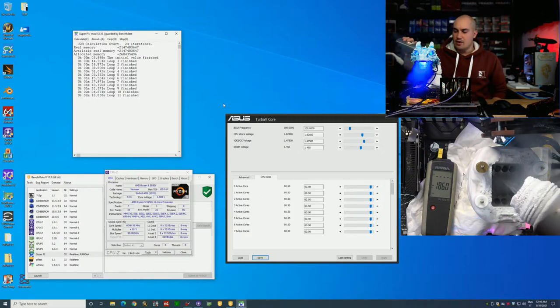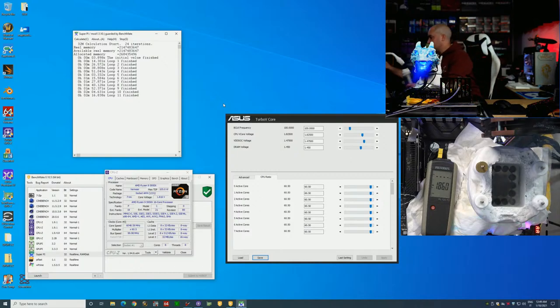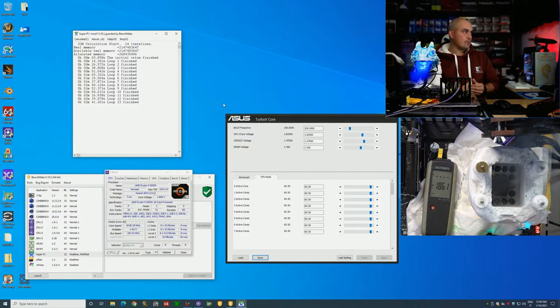Yeah, I think if I pass 11 loops, I will probably be good to make the others. Plus, maybe when I try all the cores, there's always a core that goes a bit faster, even like 50 megas faster. So if I'm lucky enough that it is not the one running the test right now, I will probably go to 6.075 or 6.1. So I can play a bit there. I can try to give a bit more frequency since we have a bit of drop. So yeah, the third position in Super Pi, I think he's almost there.